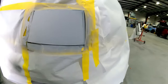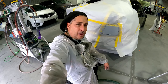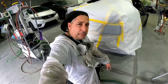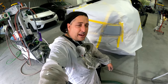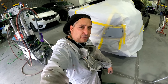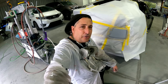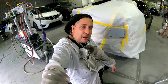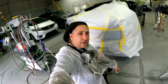And there it is — one of the best products PPG has. If you're using PPG, make sure you have this waterborne primer — it'll definitely speed you up in production. It doesn't shrink. Blow dry it between each coat to get that moisture out, almost just like water base, because this primer uses the same water carrier as the paint. Just wanted to show you guys this one. If you're in the middle of a job and need to get something primed quick and be able to shoot it in the booth, this is the stuff. Hope you guys liked it, give it a thumbs up, and we'll see you on the next one.